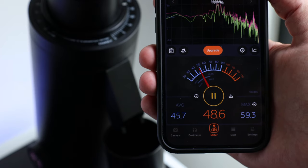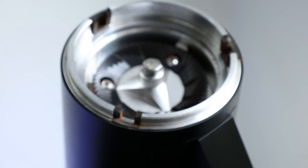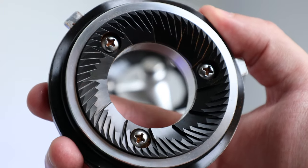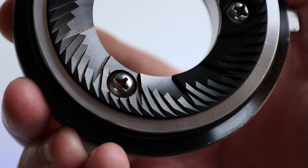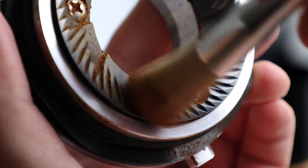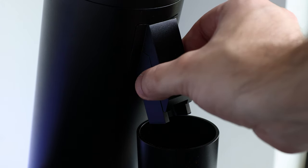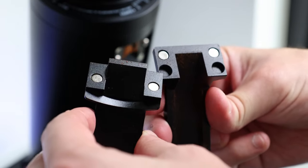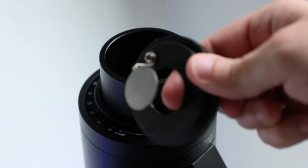Moving to the inside, the power plant is a whisper-quiet 300-watt brushless DC motor, attached to a pair of 64mm flat burrs with a DLC — or diamond-like carbon — coating. This coating gives the burrs a sleek gray-black look, and beyond aesthetics it increases hardness while also reducing friction and static. In an effort to minimize retention and maximize cleanliness, the dosing chute is removable and comes off in two parts connected via magnets, which also carries through to the anti-popcorning lid.